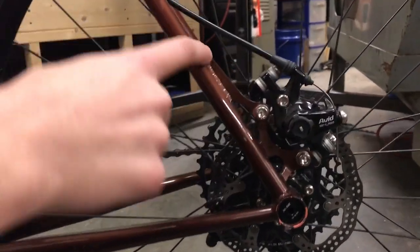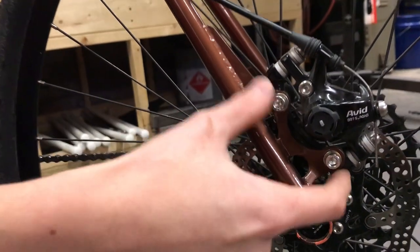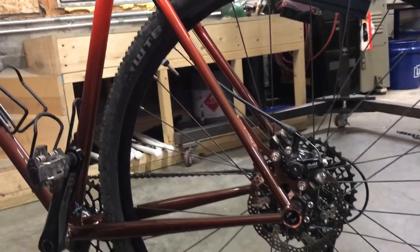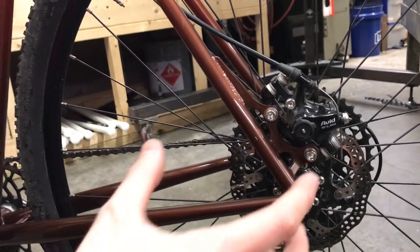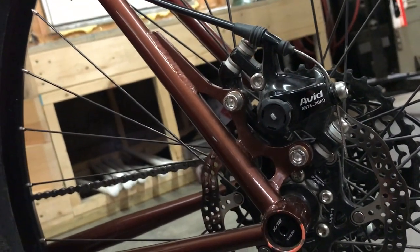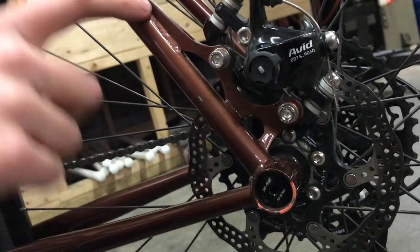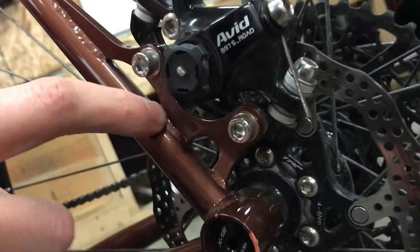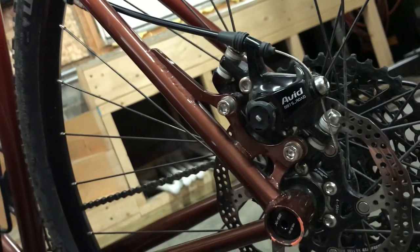This is an ISO tab for the disc brake. A lot of times people would brace this by putting a tube between the seat stay and the chain stay when mounting the brake on the seat stay, because all that brake force kind of wants to bend this tube, and you see bikes with disc brakes fail from that. This is a 140 rotor — a smaller rotor. My idea was that if I used a longer disc brake tab it would distribute the force over a longer span and it probably wouldn't fail, and it hasn't failed yet. It's a little more trick because you have to put some bends into this plate so it meets up with the tube nicer, then grind it to get a nice tight fit so there's no big gap as you go to weld it.